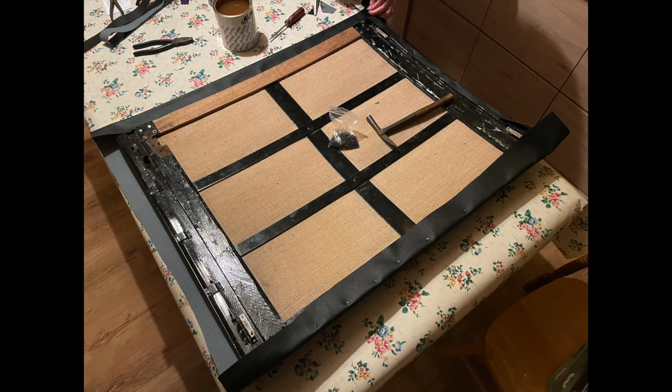So now we need to get it covered with the fabric. So the fabric is exactly the same as what we use for the large section. It's from a company called Woolies. It's an exterior grade leatherette type material, which withstands hot sunshine in the summertime. So you can see here that we started by tacking the leatherette fabric to the rearmost part of this, and then pulling it reasonably tight to cover the front bit, which will be where the windscreen is.